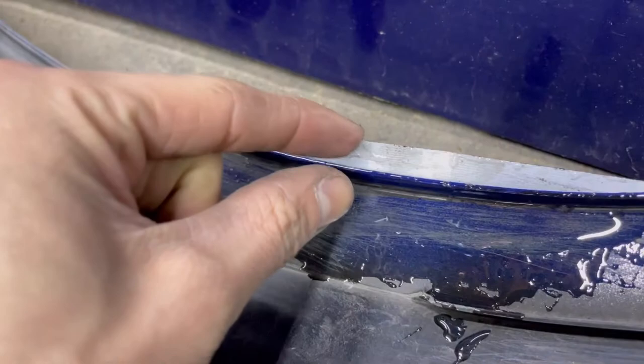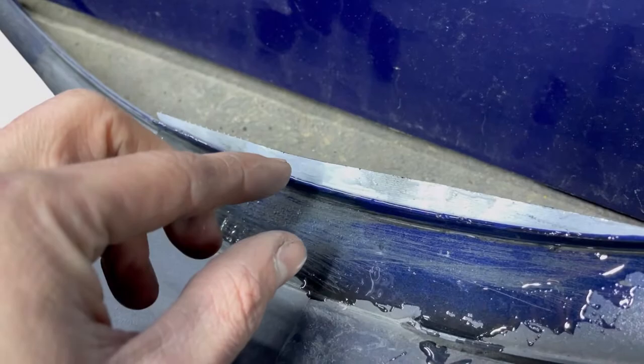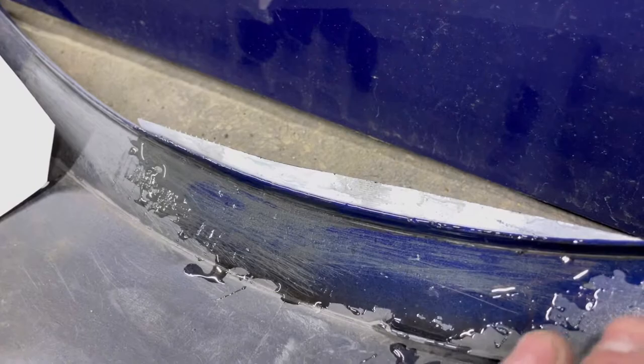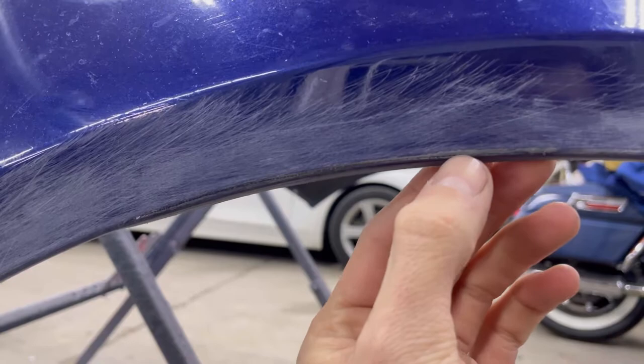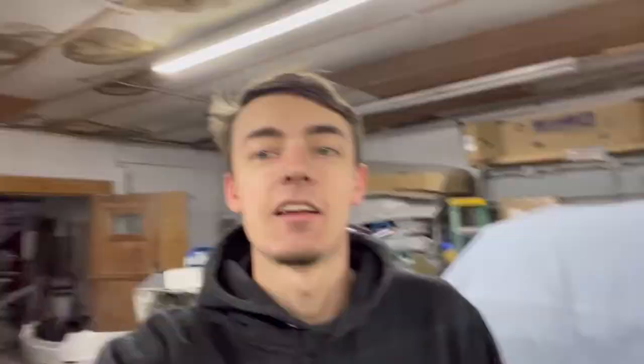If you see here in this little lip, this piece split and broke away from the bumper. We had a slight hairline crack right there. So what I did was scuff the backside and the outside with 80 grit, placed the piece where it needs to be so the crack is no longer seen, taped it with some 3M duct tape, and then I put adhesive on here. I'll let it sit, then start working the outside and reinforce it with another material later. I went ahead and filled this up from the backside — squeeze it together and the crack's not really there anymore. We can put some putty or fiberglass on the outside to finish it up.